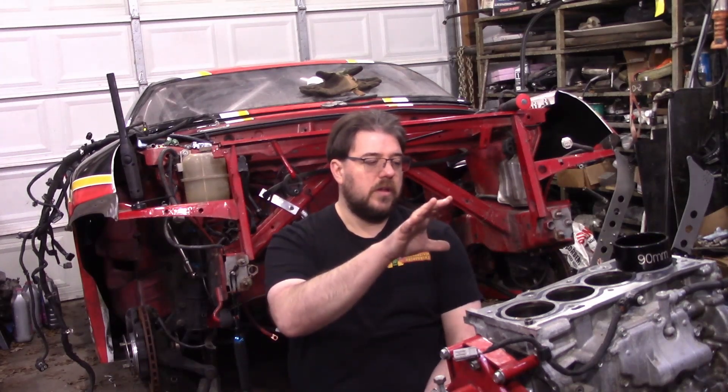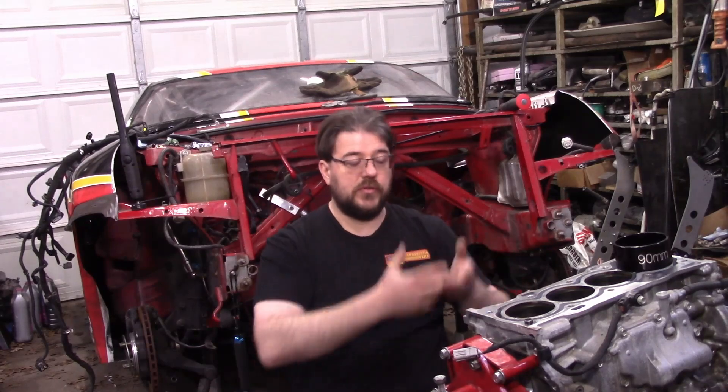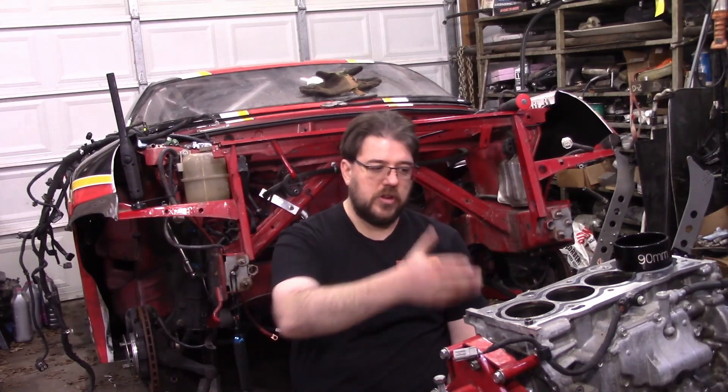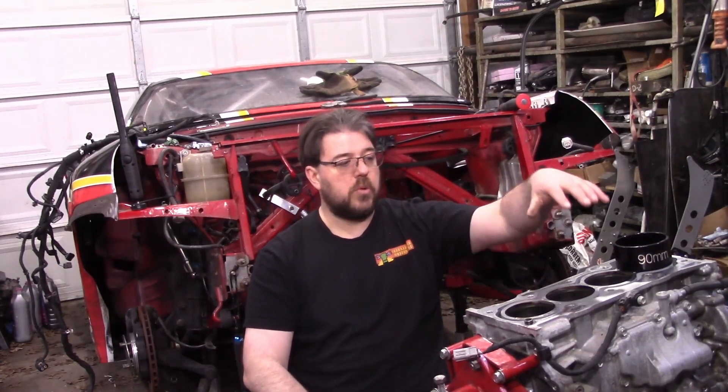I think it was injecting so little fuel that combustion just wasn't happening in the number four cylinder. There was enough combustion happening to keep it all clean. If we look at the spark plug, you can see it doesn't look like it got wet — it was running just enough to mess with us. At full throttle, this motor likes to run over 100% volumetric efficiency, but in order to do that it has to scavenge, and in order to scavenge you have to have exhaust velocity up. Even though exhaust gases were still coming out, you had significantly less because the chemical reactions hadn't happened, and it wasn't hot — so you were getting less velocity, slowing down the whole exhaust, probably reducing scavenge. On top of that, especially the two center ones were running super rich, and number one was also still running rich.